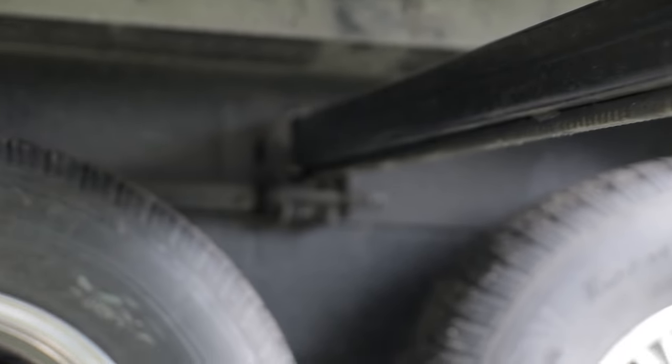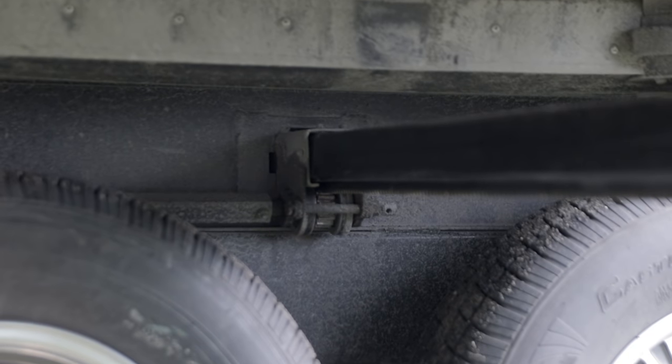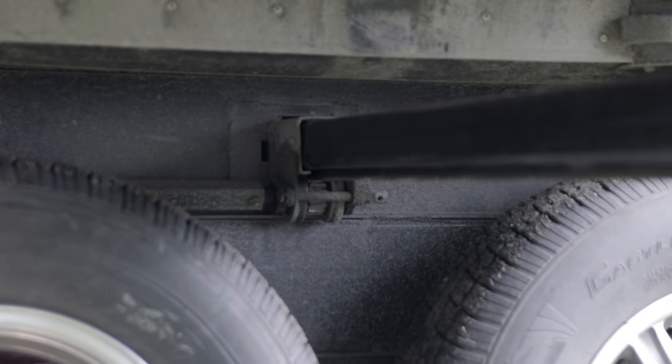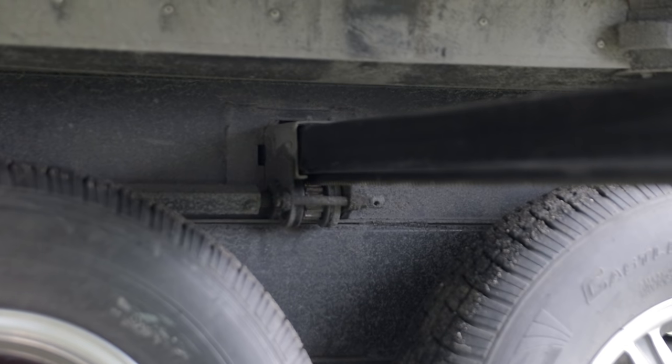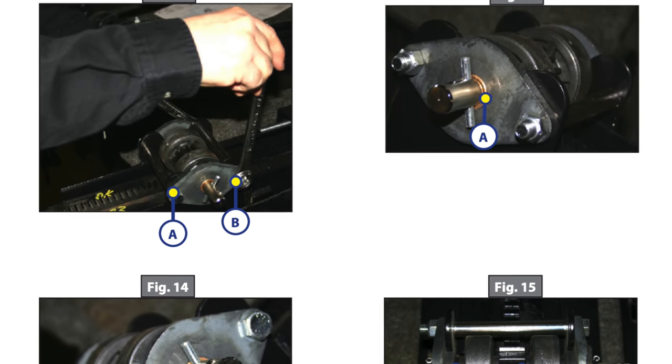For a rack and pinion slide, it looks similar to ours — you have a tube across the bottom with teeth underneath where a gear pulls the rails in and keeps everything true to the RV. I would still use a slide-out lubricant on there to protect against rust. For the gear mechanism in the back, they don't recommend oiling it all the time — really only if you hear a squeaking sound. They have a specific oil and six points they recommend for that, but it's only if it's making noise, so I wouldn't put that on a regular maintenance schedule.